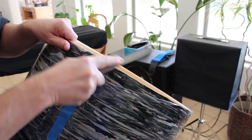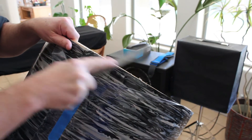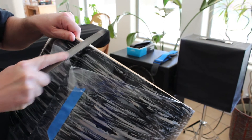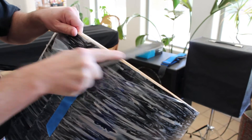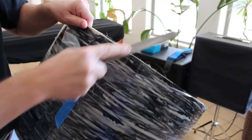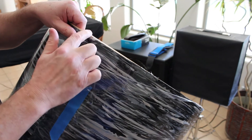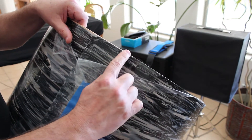This is the seam so it's going to take a little bit longer because it's double layered right in this area here. See how it's starting to come off? As soon as it starts to look like that, I'm going to carefully peel it back. If you rub it with your finger, you can see that it's taking it off right along that edge there, and I'm going to do this everywhere on the drum where this material comes up along the edge.